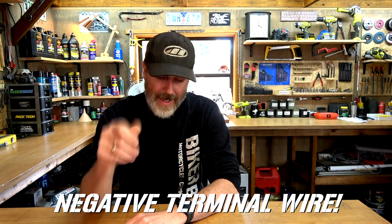Brilliant. Battery. Batteries lose charge over time. Again, different batteries, lithium as opposed to lead acid, there's differences. But batteries do lose their charge. What can you do? Get a new tender or a float charger. It's got to be one of the new ones where it doesn't just continue like the old trickle chargers where it just keeps pumping charge into your battery. You don't want that. You want one that will monitor the level and run through cycles. All good, done. Second thing with that is if you don't do that or you don't want to have that, just simply remove the earth strap off the battery, because of parasitic charges and all that kind of stuff.